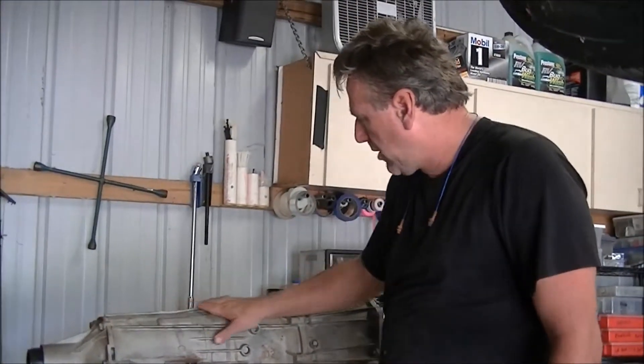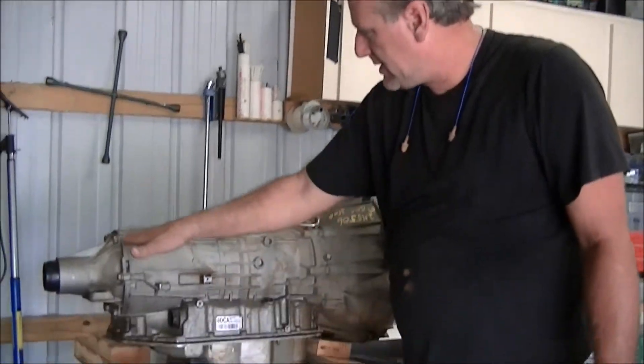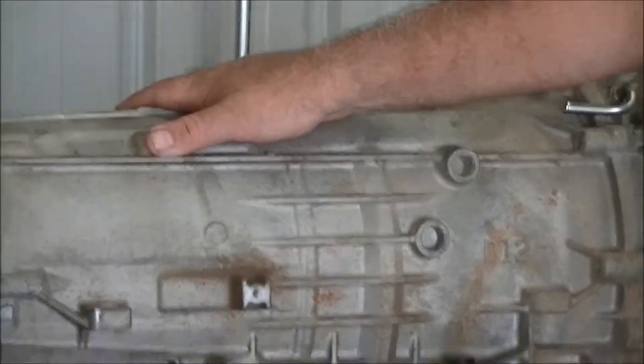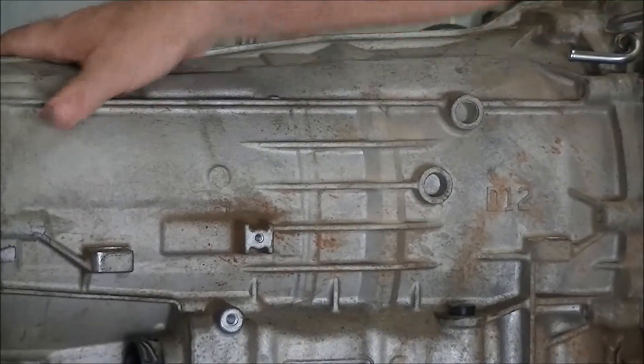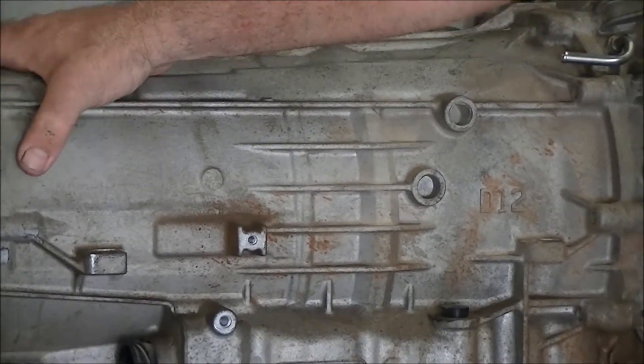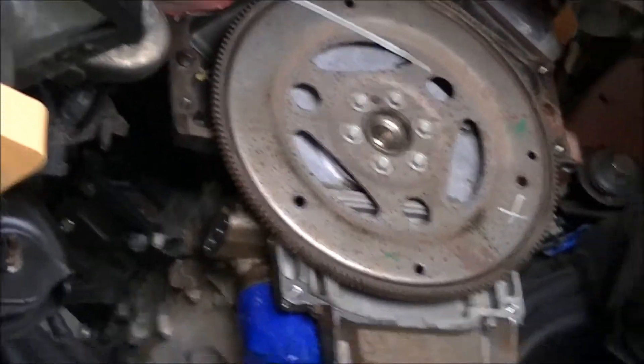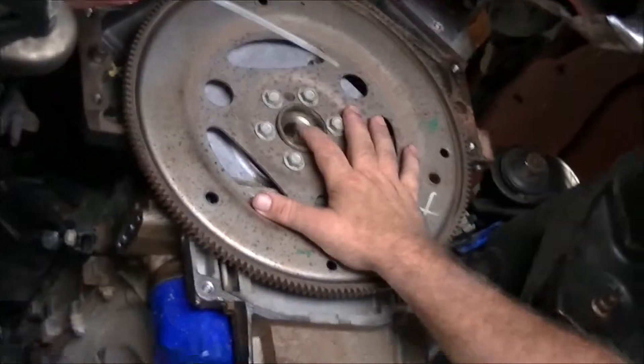The main problem lies right here. The 4L60s and 80s taper quite a bit more, and these transmissions will go right up in this truck with no modifications. This one has this big fat body with all the extra gears in it that has to be accommodated. And as it turns out, with the angle that I've chosen for the engine,